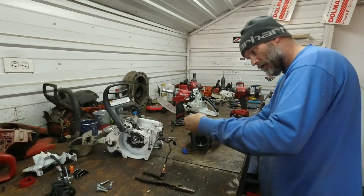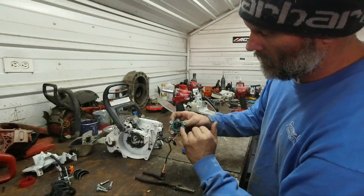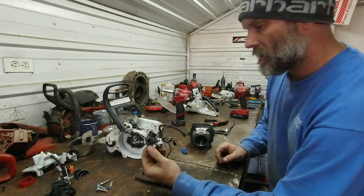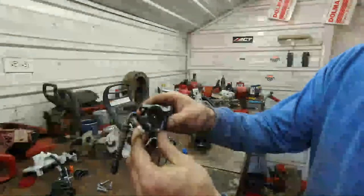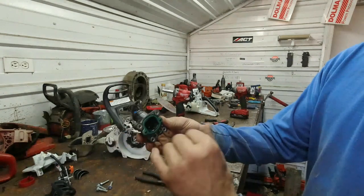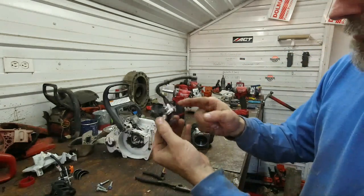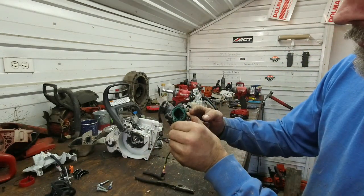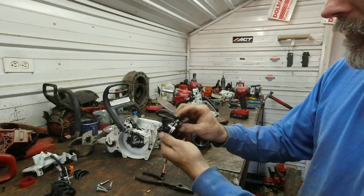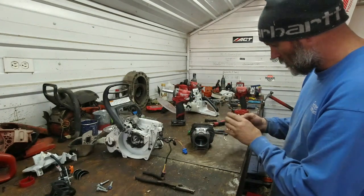We have a rubber gasket that is molded in. It's got a relief for it. Our intake right here, the boot goes around this collar. And then we have our fuel injector right in there, so that as the air comes in, it squirts. Let's see the angle here. It squirts kind of straight into the intake charge right there. And there's not much of anything I can take apart, I don't think.